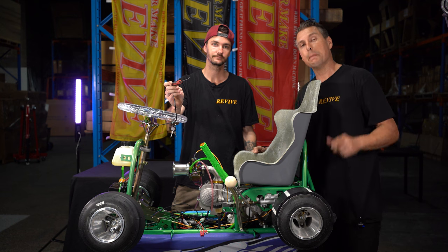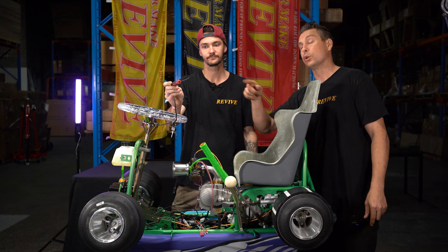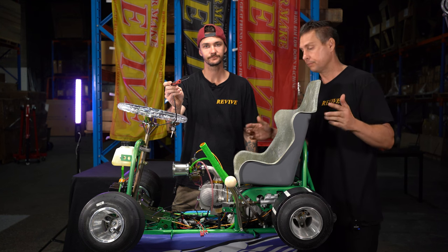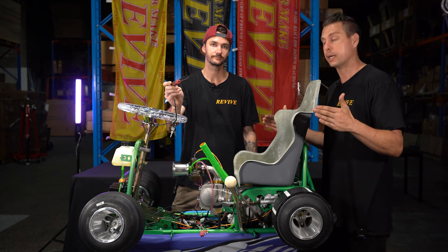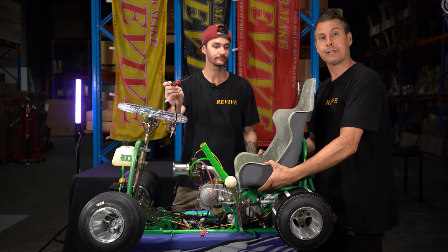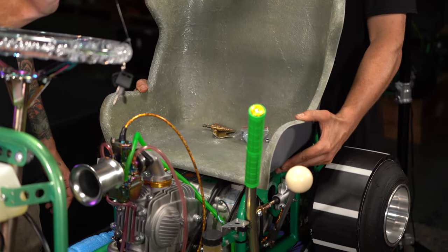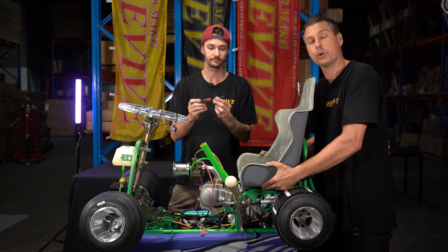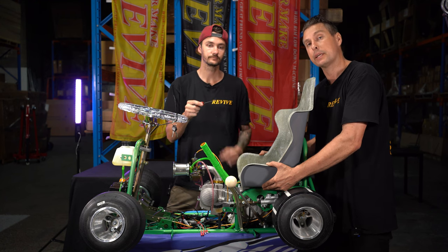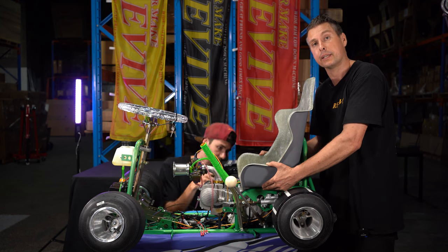In order to mark the position for our four mounting holes, Matt's holding a right angle pick. I'm going to hold the seat in place. I've centered it left and right. It's sitting flat and it's sitting back against the roll bar. So Matt's going to use the pick, the front bolt holes in the chassis, he's going to mark from underneath